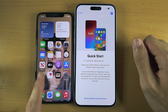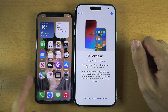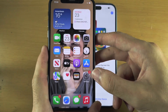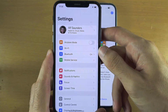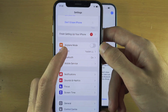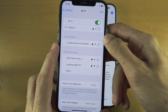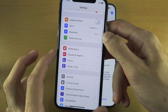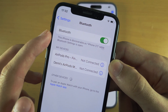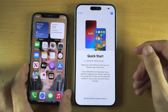This old iPhone is not showing that message, so to troubleshoot, let's open Settings. In Settings, first go into Wi-Fi and make sure Wi-Fi is turned on, then go into Bluetooth, make sure Bluetooth is on and this iPhone is discoverable. Then wait 10 to 20 seconds on the home screen.